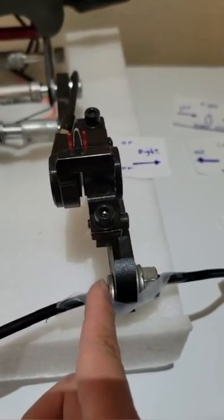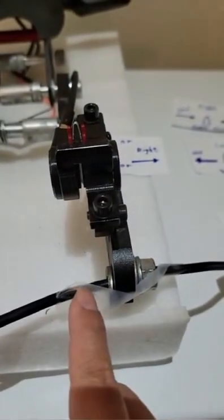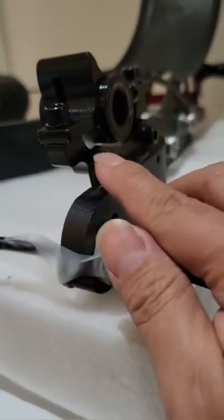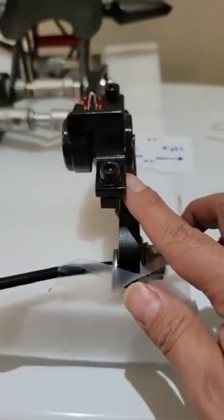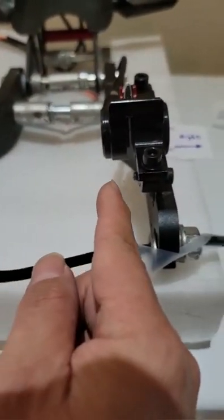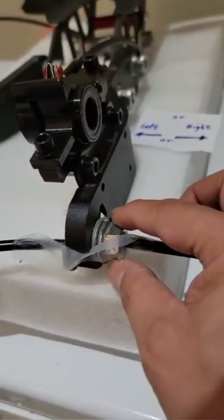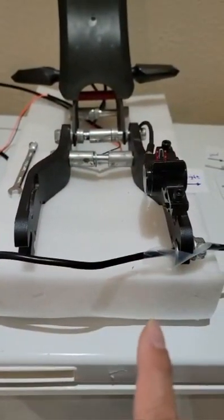If you add one more washer, the brake will go that way. This is how we adjust it. So one washer is good enough. And if we want to adjust higher, we can put a washer in here, but usually we don't need to do this. The only thing is, when the brake disc is not right, you have to make sure you have a washer inside, one washer outside, and a lock washer. So this is how they exactly decided.